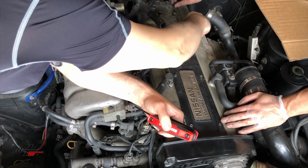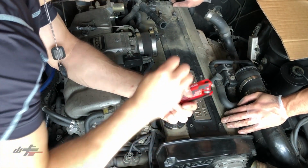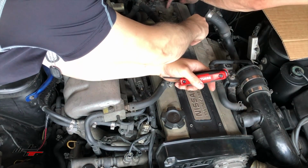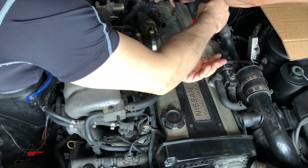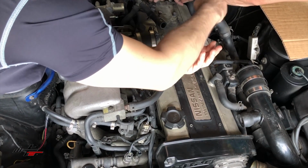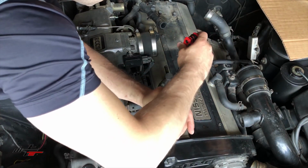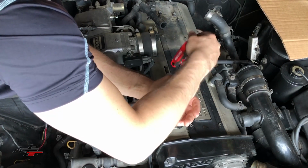That one's crossing. Try another one. Yep. Okay, here's the last one. Thank you. Put some pressure on the back of here so that they're lined up. That one went in. Might have come out of that hole to begin with. Okay, start from the inside when you torque. That's general good practice. Like a head gasket. Absolutely. Crossing around.